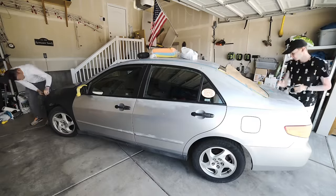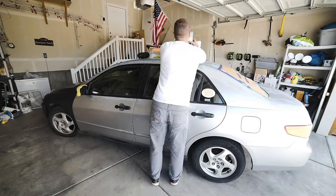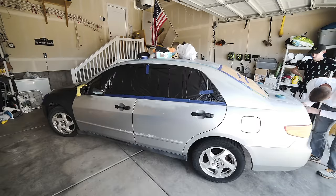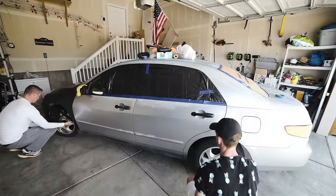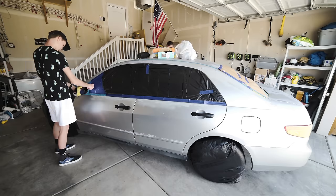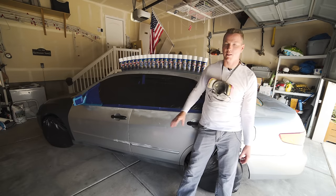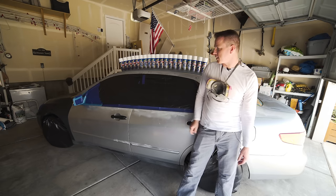Once in the garage, we masked off all the lights, the windows, and the wheels. The cool thing is you do not have to mask off your emblems or badges. Be sure to remove your license plate and any stickers on the body. On the taillights and headlights, we actually left a little gap in the tape because with Plasti Dip we could just peel off the edging for a perfect finish — we knew letting it dry in those areas would at least create a nice clean break. We've got the car totally prepped: sanded, washed, completely dry, no humidity anywhere.